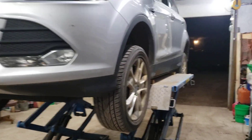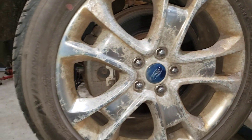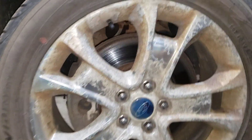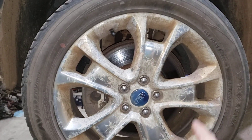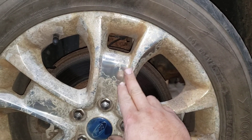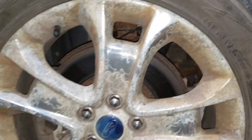For starters, we've got some seriously corroded wheels. There is a concern about tires going low — once they start getting corroded on the outsides like this, they're always corroded at the beads. So we'll be breaking those down and sealing them up. The tires themselves are also a concern.